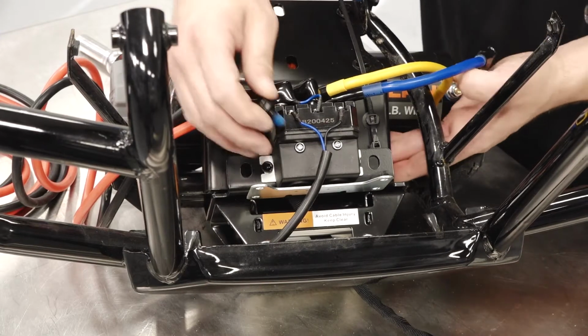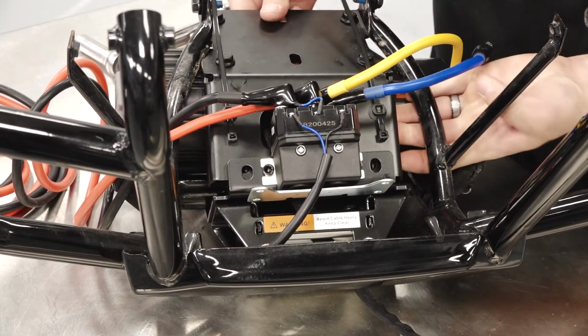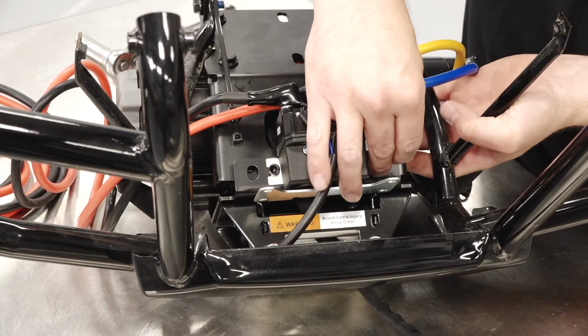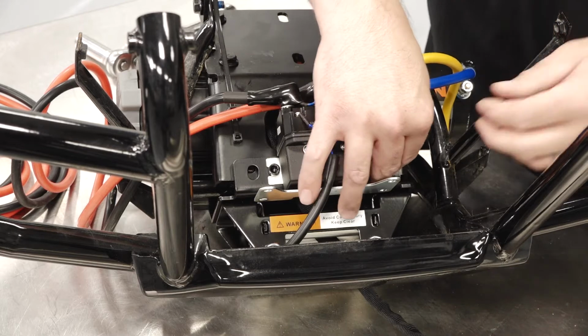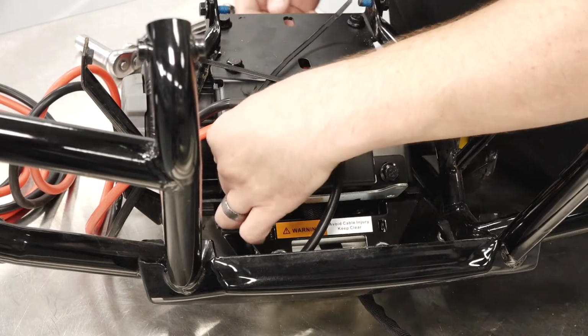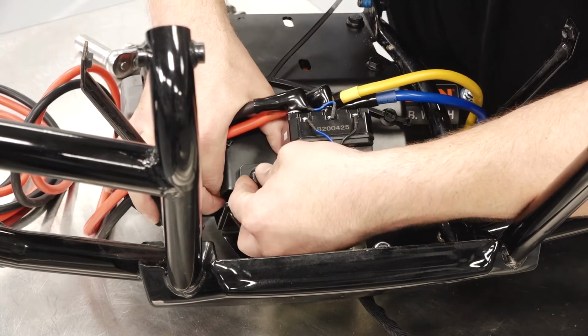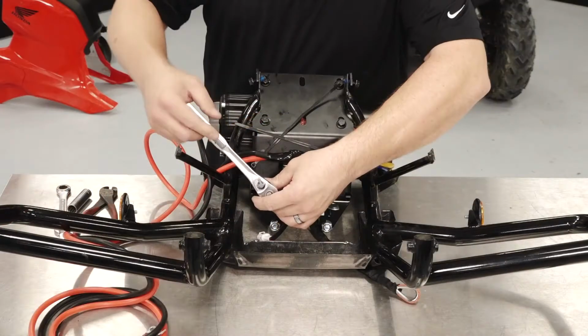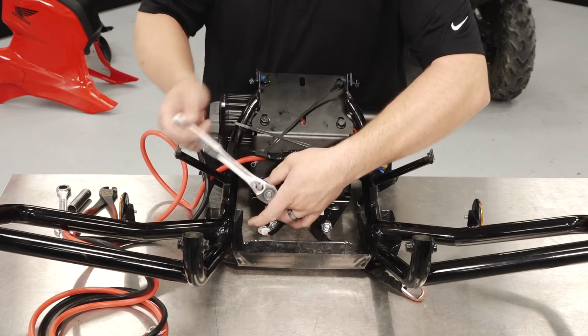We'll use the 2 M8 screws, and then we'll position those through the holes on the roller plate into the winch plate. And there's threaded tabs, and then we'll thread each screw by hand into each tab. Tighten and torque the 2 M8 screws to specification.